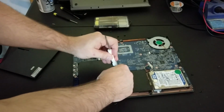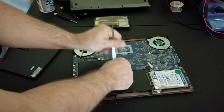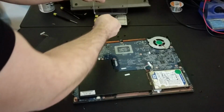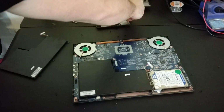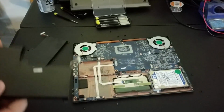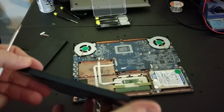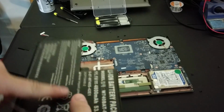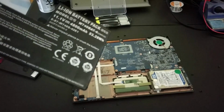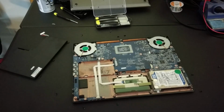And I could tell we're missing some screws here from this battery, which tells me this laptop's been worked on before. These batteries probably have a high propensity of failure. And this is our battery, and I can feel it immediately, the swelling on this battery. It's starting to lift from its cage, but you can feel it's puffy all over the place, letting us know this battery has definitely met its day, and is why it's starting to push up ever so slightly on the keyboard.